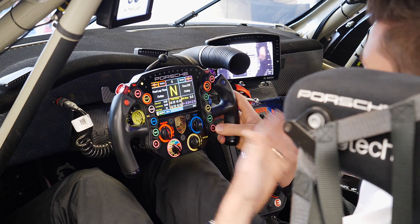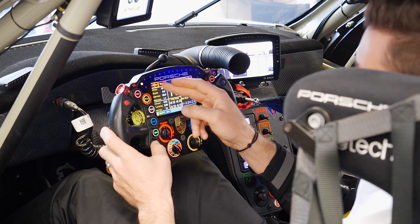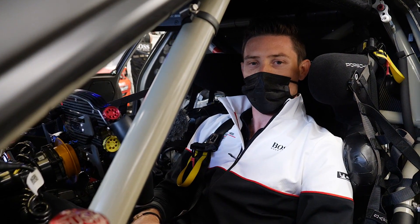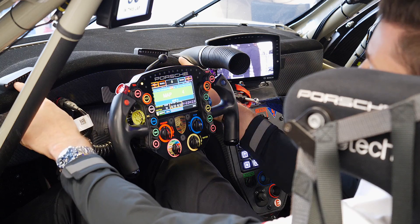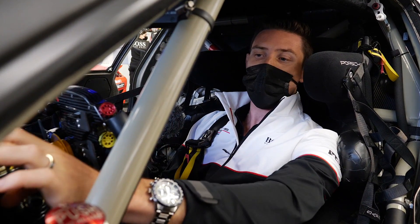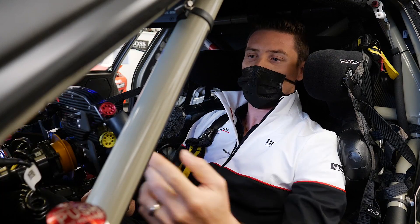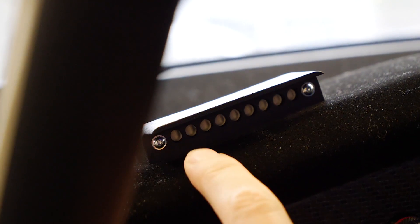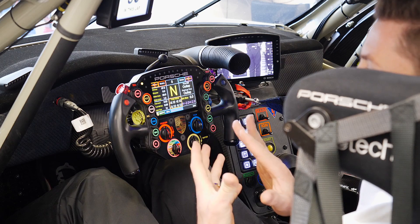On the pages you can have different pages you want to see — this is more for the mechanic, but while driving you can see your fuel or essential engine data. One very important thing: these are the lock light and TC light. When we brake and lock the rear, this goes yellow; if we lock the front on braking, this goes purple. When we activate the TC, it goes blue. This is very helpful to know if we are using a lot of traction control, or if we lock the rear we can release the brake straight away, because we don't have ABS — as soon as you lock the tires you lose time and can damage them.